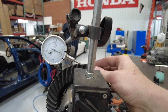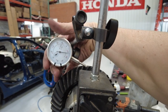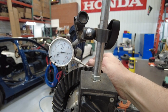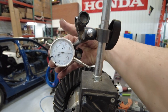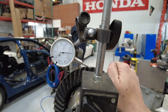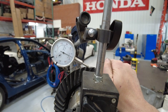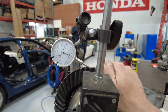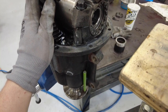Got that bearing tensioned up a little further, holding the pinion nice and firm. That's looking pretty good — we're looking at about five and a half thousandths right now. That's perfect. So we've got five and a half thousandths of backlash on the ring and pinion, good bearing tension, and the solid sleeve installed.